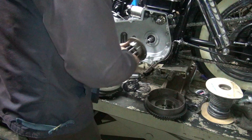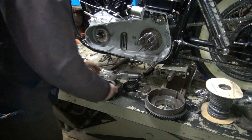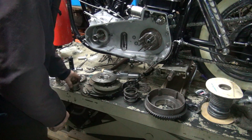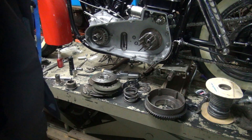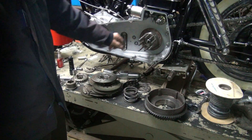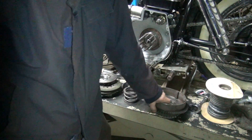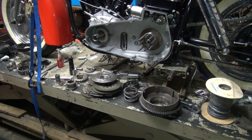We need to check our chain alignment, see where it's at. To do that, put the parts on there — the motor sprocket up here, here's our hub, and there's our sprocket. That's a rough idea of where you're at. There's supposed to be an offset from the front — it's supposed to be 200 thousandths, is what we call it. So if you put a straight edge coming across here up to here, there should be an offset. Looks like this side is in further than the other side — I think that's how they're supposed to be. What I do is put the basket up in there and see what we really have, coming right off the teeth. I'm going to try the straight edge trick, so let me go grab the straight edge.